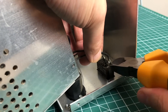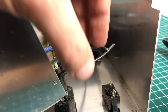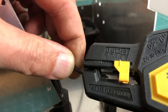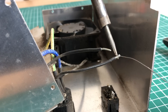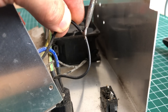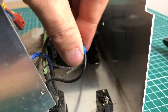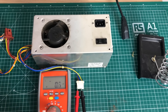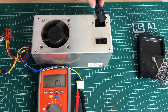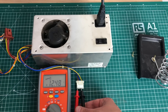I didn't have a replacement switch, so I just decided to unplug the two power cords and solder them together so that the PC would always be on as soon as a power cable is hooked up to the power supply. This is a temporary measure — I'm going to be looking for a replacement switch, but this will have to do for now.